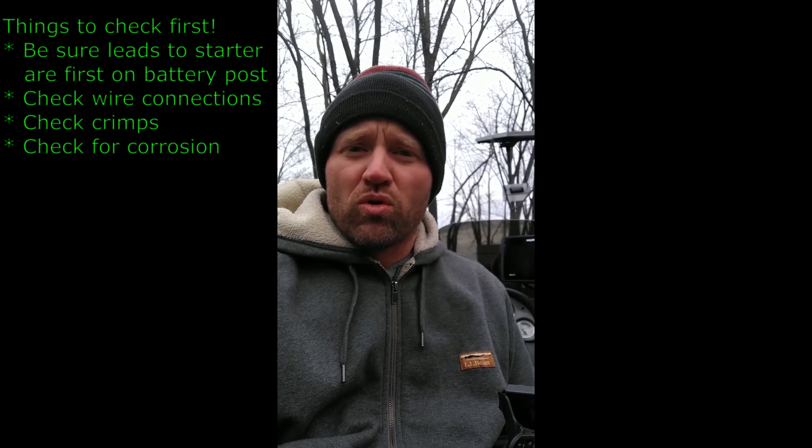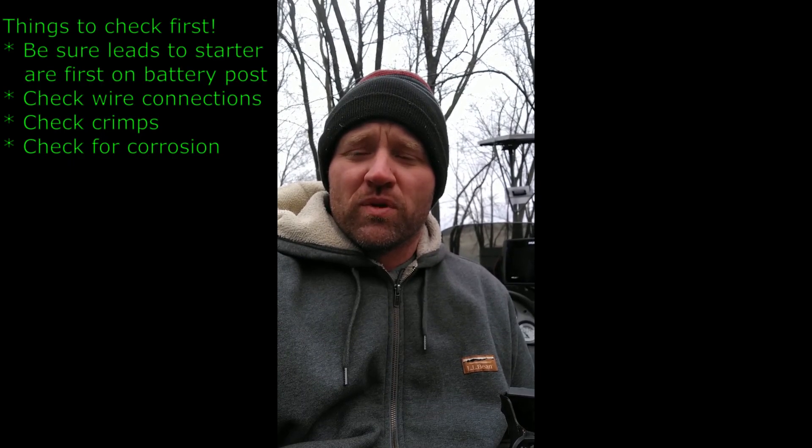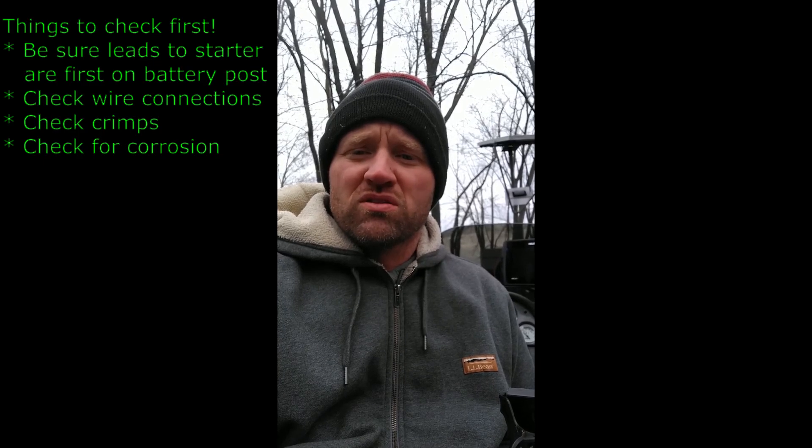Getting pretty annoying, so of course I hit the internet and went to a few forums. Guys are talking about all kinds of different solutions for this. I think it's not just a Humminbird problem — essentially anything where we have a big voltage drop on our system, there's an opportunity for it to cut out. A couple of things to look into: check the orientation of your connections to your battery, making sure your starter motor leads are the first thing attached. Also look at your fuse panel wiring and make sure there's no corrosion, same with the battery leads going directly to your electronics.